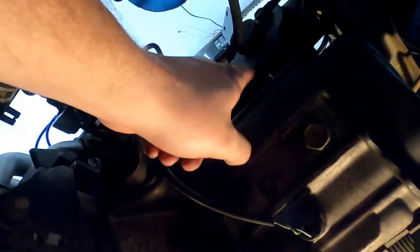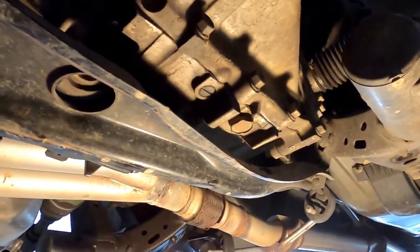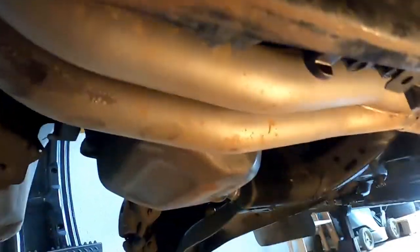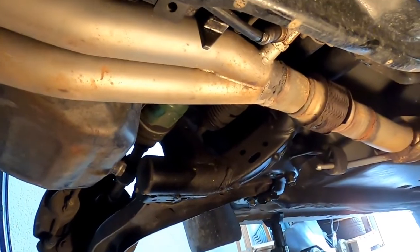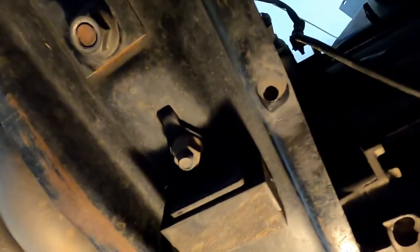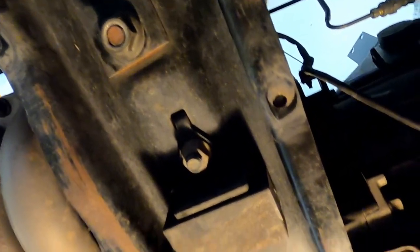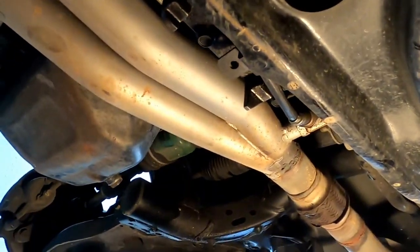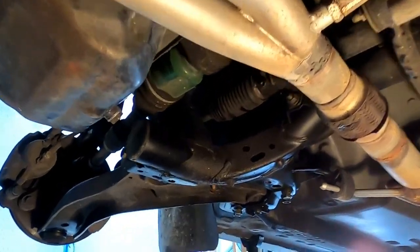This one should be able to hold the transmission up while we take off all of this, but I do have a small screw jack that I use to support these. Put some blocks here, and I'm going to put it on the corner of the oil pan, hold the engine up, and we're gonna pull this off. So 17, 17, 17, two here, and now we're gonna pull this off. Once that's done, I've got that blocked up. The next step,